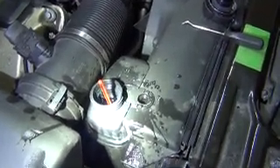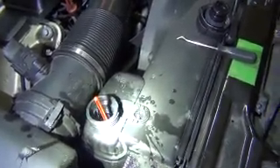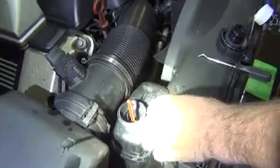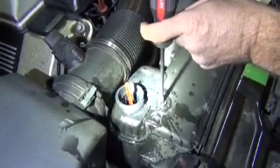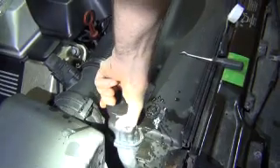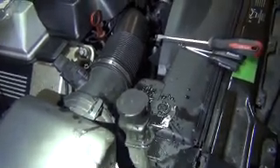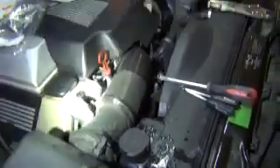You can't normally hear it over shop noise. Now after you're done, install the bleeder screw back in and snug it down gently — it is plastic, so just that seal is holding everything in place. Then the radiator cap. Run it up to temperature, let it cool, and recheck your level to see if you need a top-off before a long drive. Make sure to use the correct coolant — there is a BMW coolant, ethylene glycol based, and you don't want to mix coolants. I hope this is helpful, thanks for watching.